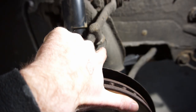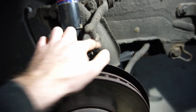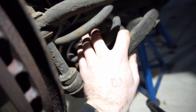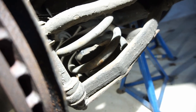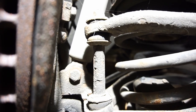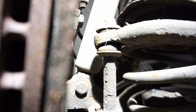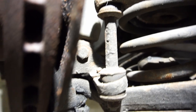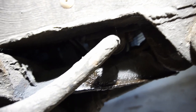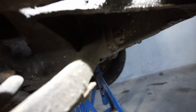One thing that is missing is we're missing one bump stop over there, but the one on this side is intact, so that's not really a safety issue at all. I'll just order some for both sides and replace them at some point. The bump stop in here looks fairly new, and the spring also looks fairly new actually, so that's really good. We have the anti-roll bar bushings here — there's a tiny little crack in a few of them, but they crack and compress really quickly. As long as they're still there I'm happy enough to drive it for now; I might replace them later because they do help a lot with handling, but not too bad to start out with.